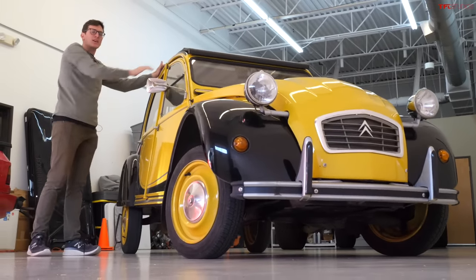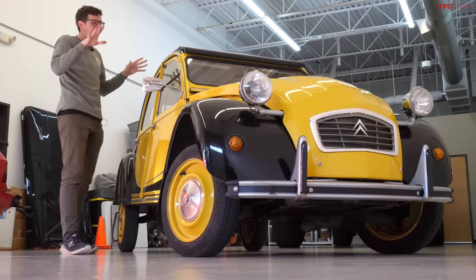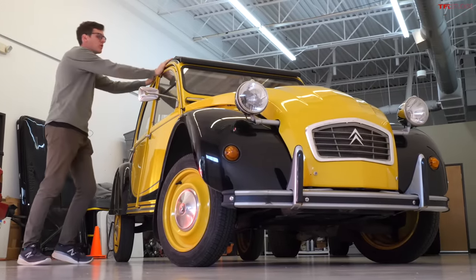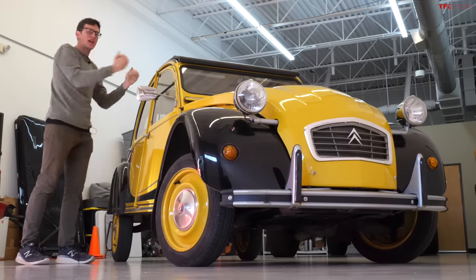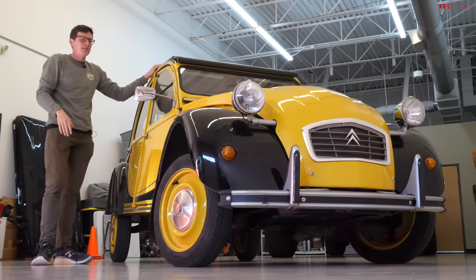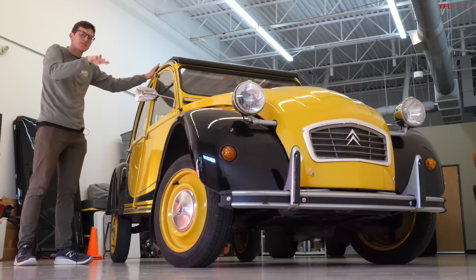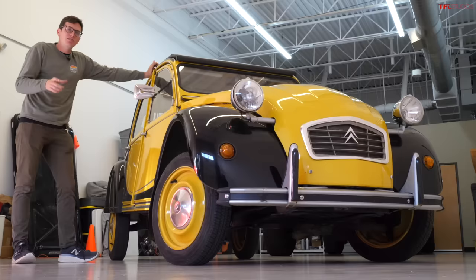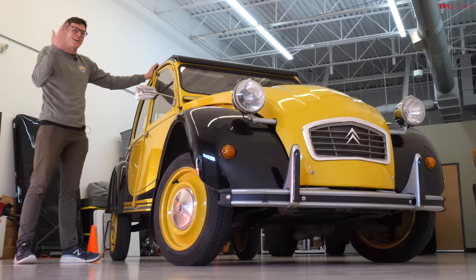Now, of course, in the 2CV, you do have an enormous amount of roll left and right, but that interconnected aspect of the front and the rear suspension is actually less important when you go to roll the vehicle over in a turn, because what you're doing essentially is just pulling both tie rods an equal amount as the entire car leans over. So that kind of front to back motion doesn't really have a very big impact on the left to right.